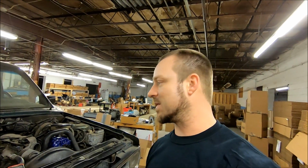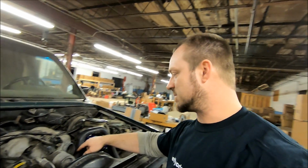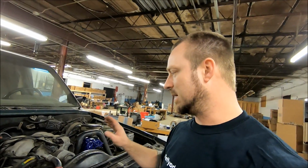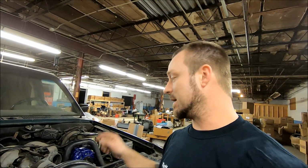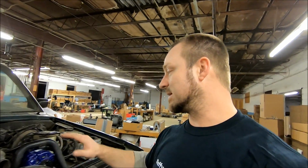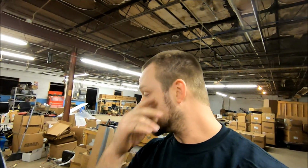I know y'all might want to see me crank it up and run it, but this thing still runs a little rough, so you kind of gotta pat the throttle a little bit. Plus it's not very happy. I've got the intake air temperature sensor disconnected because I haven't put the duct back on it, so it's idling kind of bad. But just trust me, you see where the voltage is sitting, crank it up, the alt's working, it's charging. It's awesome. I think this alternator is going to do great charging all 20 banks of those caps.